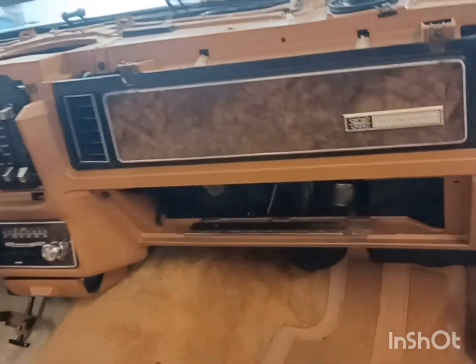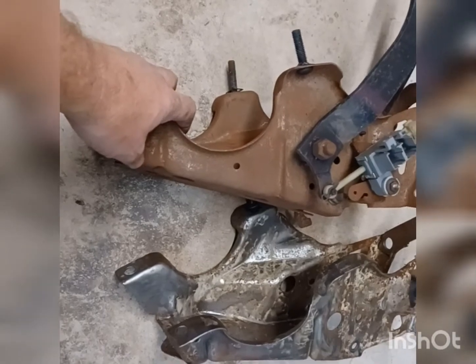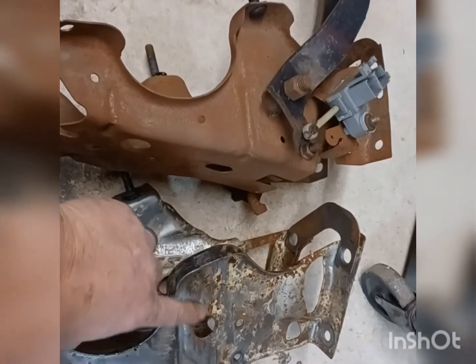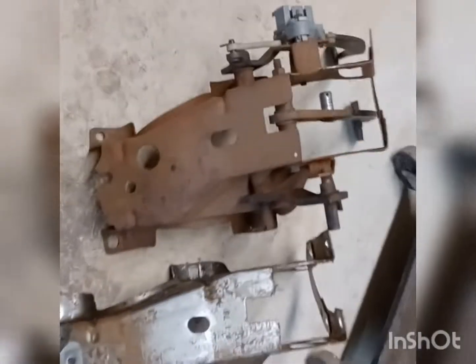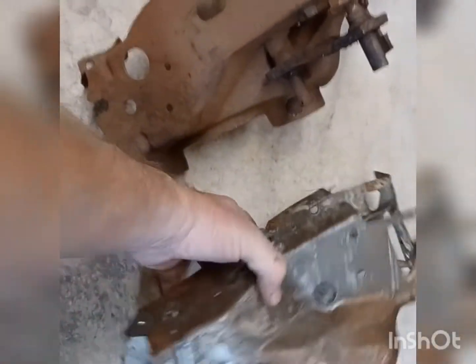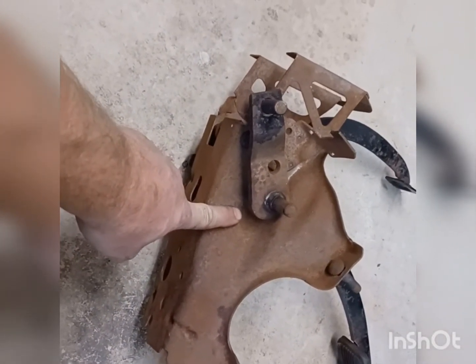Just deal with me, we're making it happen — a little at a time, every day. It's a good thing they kept everything the same before the Fox body came along, because this is a 78. The only difference is there's a shoulder built in for the clutch pedal that's not in this bracket, so I have to change the whole bracket. But the good thing is it is identical — the only thing really different is where the dash bolts. This one is slotted, on the other it's one hole. That is it, everything else is the same.